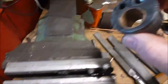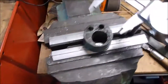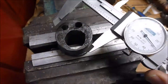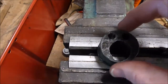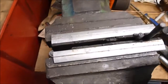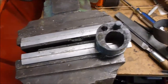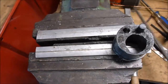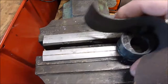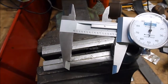The other problem — watch how loose this is. I put the calipers on it and realized the new bushing is a bit oversized for the inside diameter of that tube. I don't have a lathe, but I have my methods. I needed to hold the new bushing still and take some outside diameter off it. To hold it steady — 5/16ths, remember — two drill bits chucked up in the vise. Anchored nice and firm. Then with a series of files I cut around with a finer file and kept doing this, hitting it with the two-handed sandpaper technique. I eventually got it down to about 1 inch and 6-tenths of an inch in diameter — now it drops in there nicely and snugly.